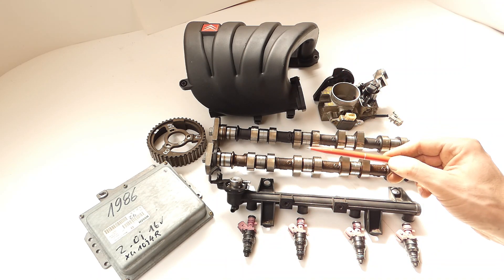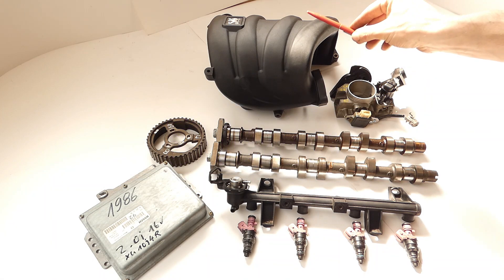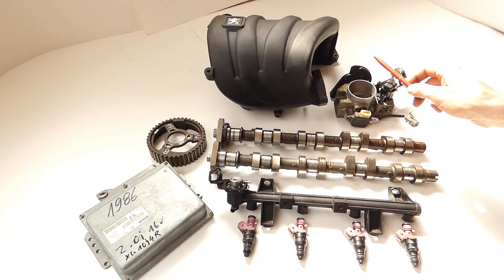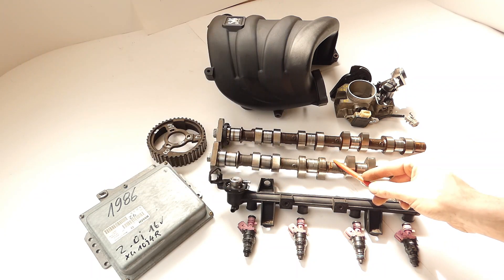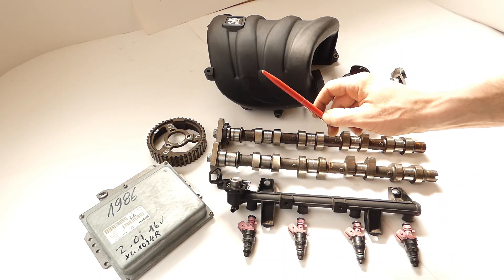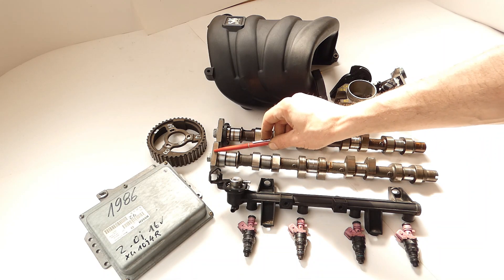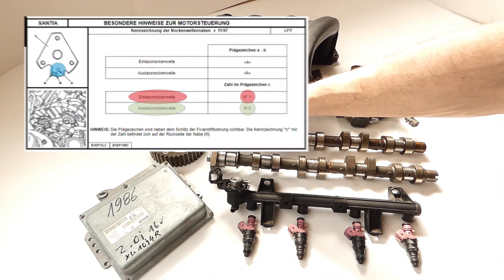Now we see my personal third upgrade variant, where quite a lot has been changed. We now run the large intake manifold from the 2L 16V, milled out. We remember, the dimension didn't fit with the 2L throttle body. We run the exhaust camshaft from the XU10 J4R and the inlet camshaft from the XU10 J4RS. Injector rail from the XU10 J4R with matching injectors and of course the ECU as well as the adjustable camshaft gear. The plate for the camshaft gear from the 1.8 inlet camshaft also fits the XU10 J4RS camshaft and the timing pin point is identical, so you can use it to run the adjustable camshaft gear.